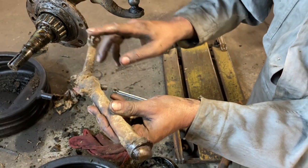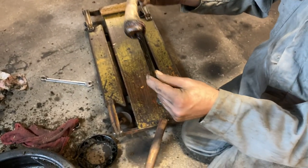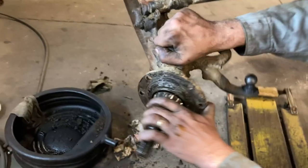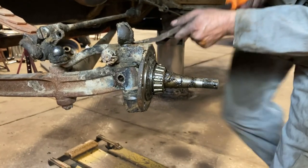This is our actuator here. See how it works — the brake rod comes in, it pulls and pushes down on this little rod. It runs through the hole in the kingpin and on the little wedge — pushes your wedge and there you go. Now we should be able to just ease this kingpin out of here with a bit of leverage.